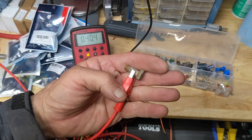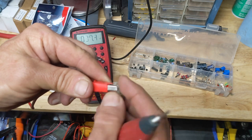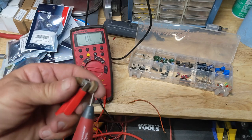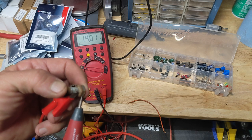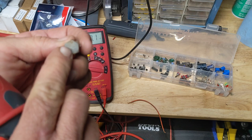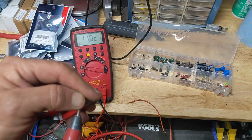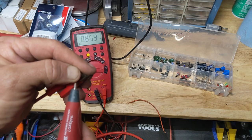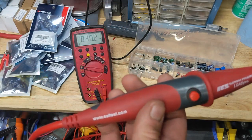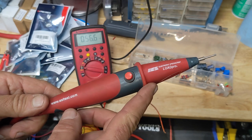Let's try this through what might be a ground bolt. I've tried to get the alligator clip to make a good connection — see, it's all shiny in there, I wound it back and forth. Touching the probe to the terminal and holding it pretty well, I've got 14.01 volts. I push the button, and now it drops to 13.6 — so that tells me, because that's pretty corroded, this is not making a good connection. Checking up on this end, I've got not quite 12 volts, and if I push the button it drops way down. Anyway, handy tool — I can't get out to the bus right now because of all the snow to show you any diagnostics, but it will identify problems in circuits when some of my other tools won't.